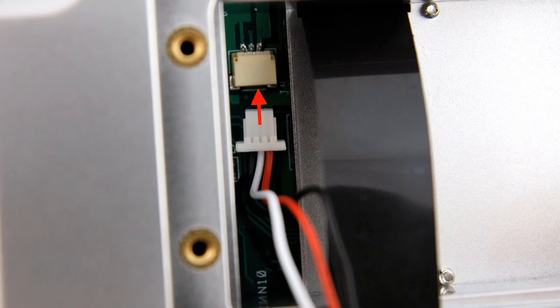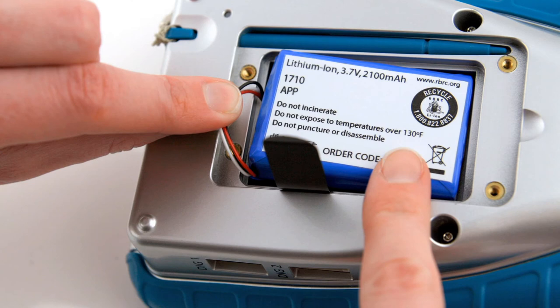To replace the battery, repeat the process in reverse. Put the plug in so that the red wires are towards the bottom of the unit — this is the correct orientation. Very carefully plug it back in. You can use your finger, a stylus, or a small screwdriver to get it in there, but again make sure you do not pull up on the wires. Then carefully tuck the wires towards the top of the battery. You don't want to bend them so you damage them — there's a little space to tuck them in. Make sure the battery pull tab is underneath, and then you're ready to put the back on the unit.